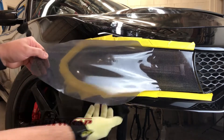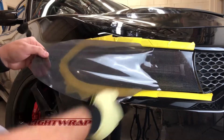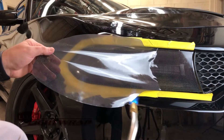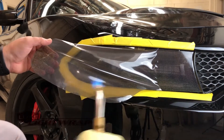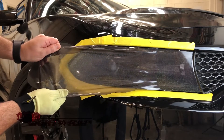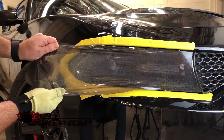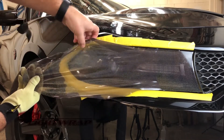The reason we want to do that is we can then lift these flaps and heat the vinyl back up, and it'll naturally shrink into place because of the stretch we put on it. You'll be able to tell when the vinyl is hot — you can see it gets nice and soft. Once it's soft I'm going to reach in. It's okay if it touches itself. I'm going to pull some stretch — you can see that I've got the vinyl stretched out now. I've let it cool down so now I can handle it better.